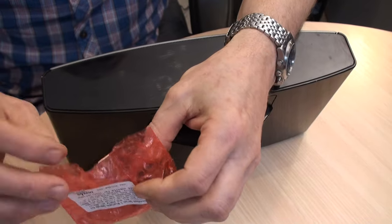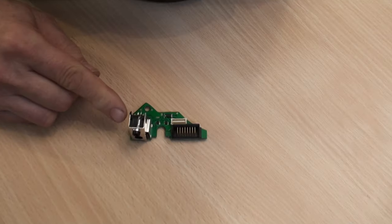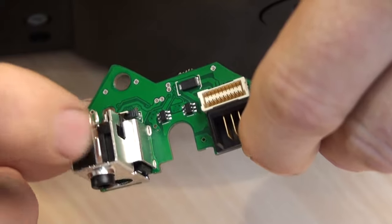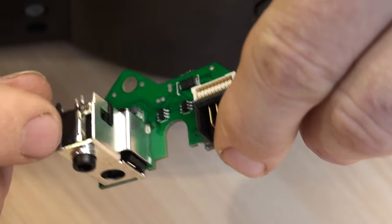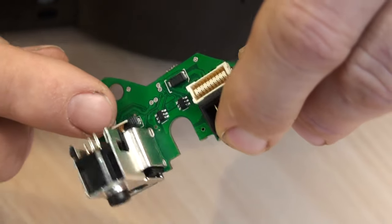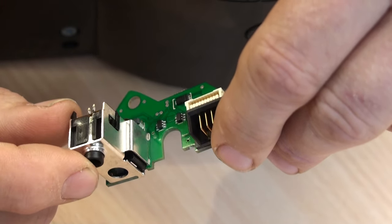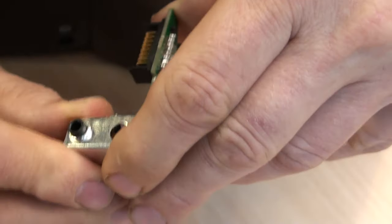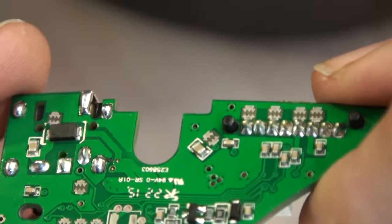Also the DC jack can be a problem. To fix this you need to order the PIO replacement board for the SoundDock Portable from us. It has an upgraded steel connector with the same configuration and layout. On our design the jack socket is exchangeable — it snaps out of the metal bracket mounting so you can unplug it and plug a new connector in. The board has a very strong metal housing for the connector, not plastic — a very rugged design, but functionally the same.